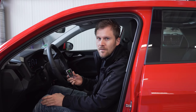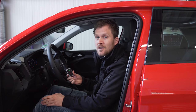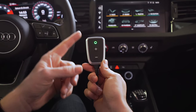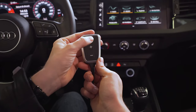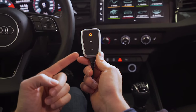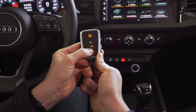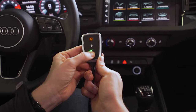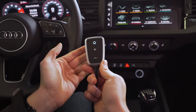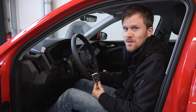All programs are now perfectly matched to your accelerator pedal. The PedalBox starts in factory setting with the first program, city. With the program button, you can switch to program sport and sport plus. To fine-tune the selected program, use the plus or minus button to increase or decrease the throttle response. The stock mode sets the vehicle in default setting. A key feature: the PedalBox always starts with the last settings.